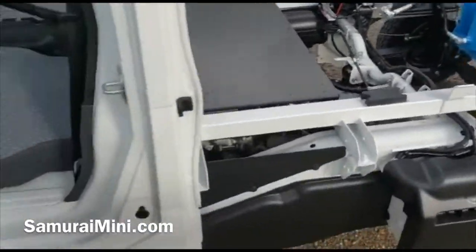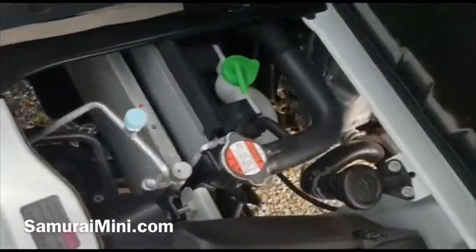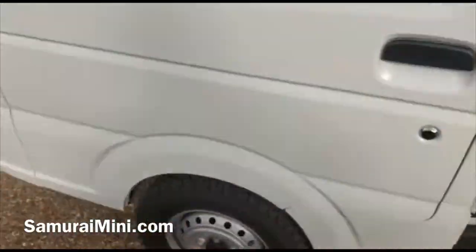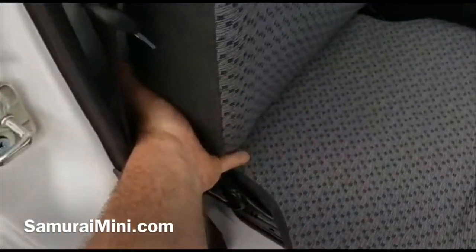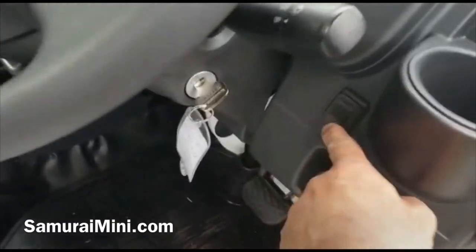In here is where you check your fluids. Check your coolant here, check the oil there, top up your oil there, and there are tools to change the wheels. On the other side is where you check your washer fluid. The dipstick for the oil — just lift this seat up first, you have to pull it forward, there's a little clip down there, pull the seat forward and lift that up — and there's your washer fluid and dipstick, nice and shiny.